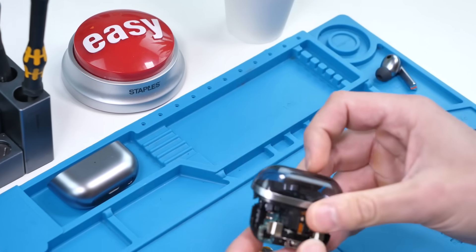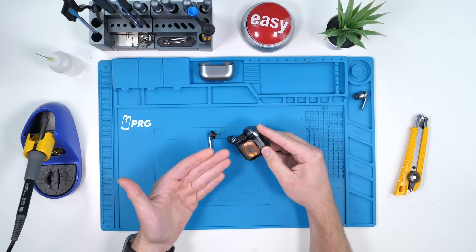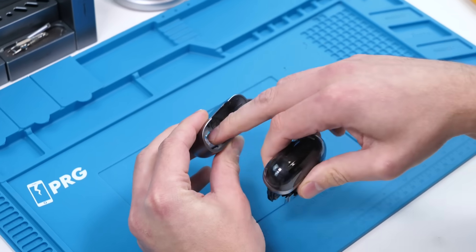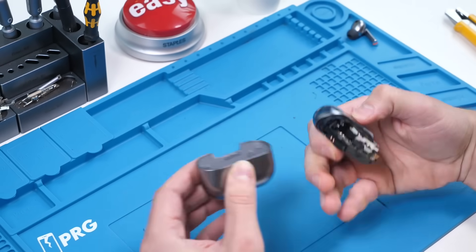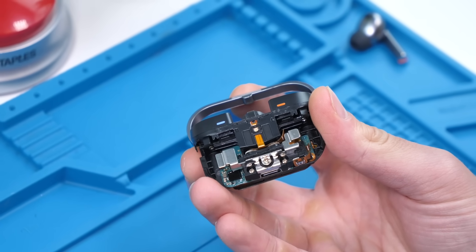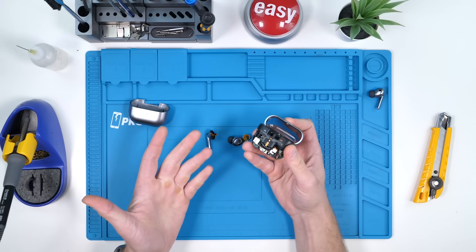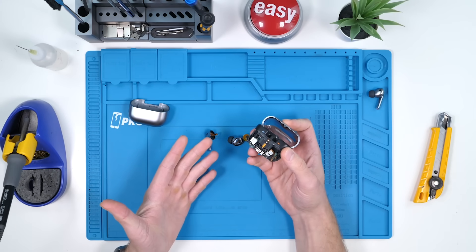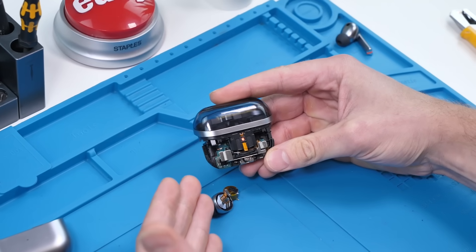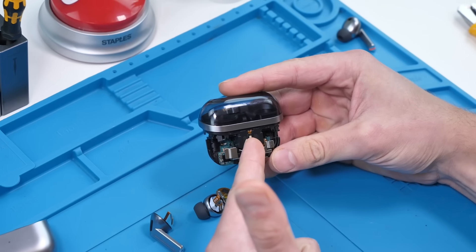It's not as hard as I thought it would be. As for the case — just look at it. This is extremely repairable. The battery is very accessible and you can remove the whole part without actually damaging the housing of the case at all. The board is extremely accessible — you just have to remove a few screws. The only thing that kind of sucks is the fact that the USB-C port is soldered to the board, but you can always get that re-soldered. It's not a huge deal. All in all, these are so much more repairable than AirPod Pros. Sure, they may look like them, but they definitely don't repair like them.